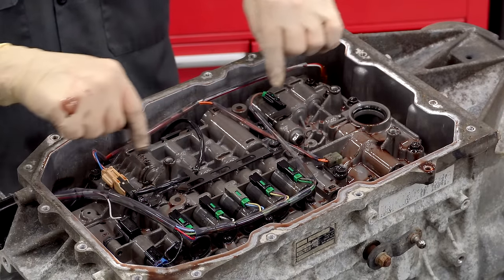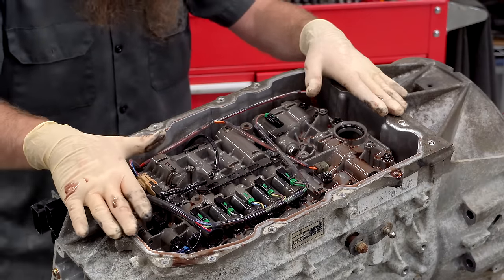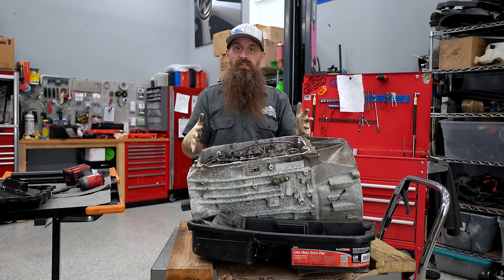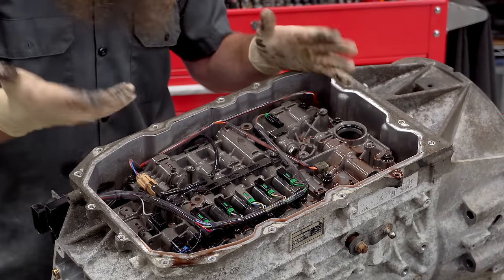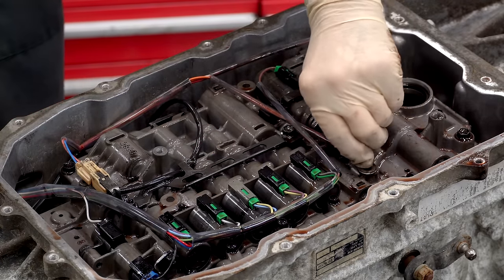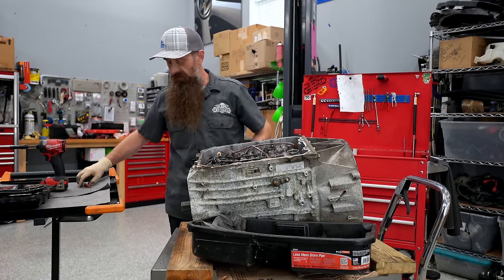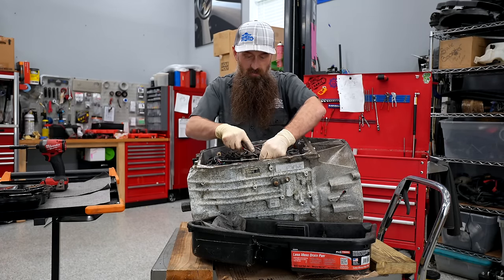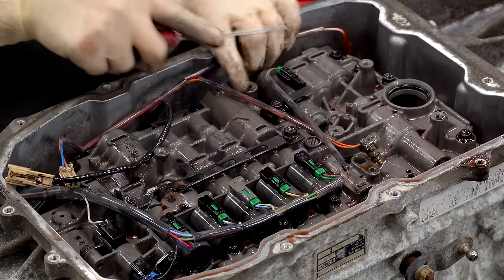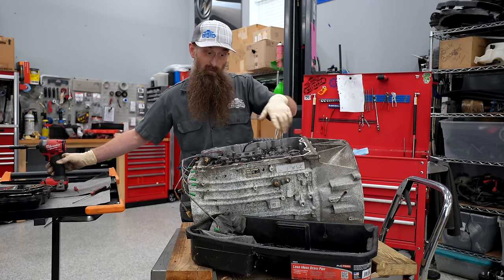What I have exposed here is the valve body. This is all the electronic solenoids and fluid passages that control all the stuff inside the transmission. Now, this is a basic style automatic transmission — there isn't really a whole lot that is going to be exponentially different about this versus any other style automatic transmission. These are the solenoids that control all the goodies. I actually think this little sensor was a failure point at one point. Back in 2004 there were a few cases of exploding solenoids — you'd take the pan down and this would have just exploded. We've got a pretty good size harness here for these solenoids, and it is separate, which is what these connectors are for right here at the back.